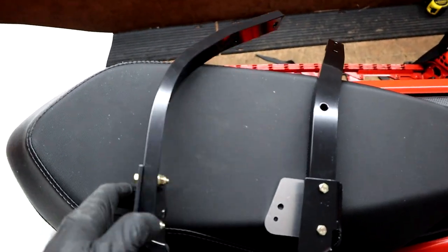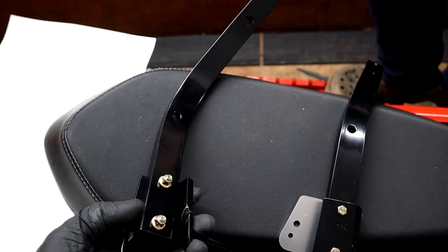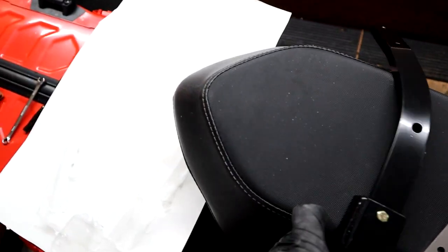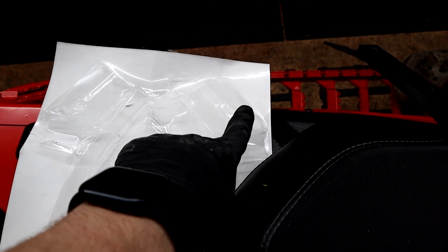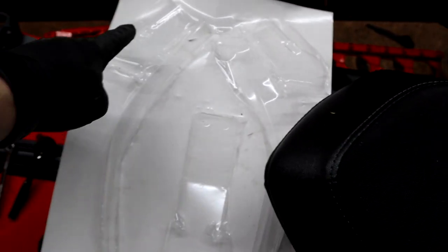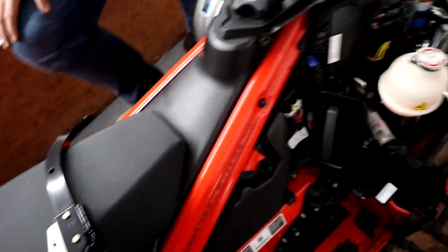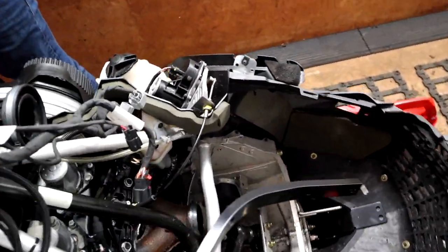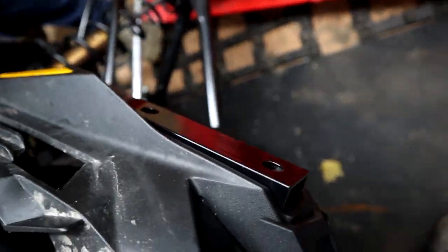I had to build these brackets twice because Ski-Doo, in their infinite wisdom, didn't package them very well. The instructions don't show which way the bend goes. If you guys do this yourself: the bracket on this side uses this mount, and the bracket on that side uses that mount. I don't know why they didn't just package them side by side. Where it goes is right here, and the holes we drilled earlier are right there — it just gives a mounting place for the front of the bumper.